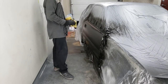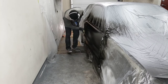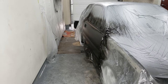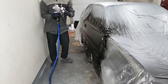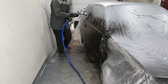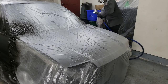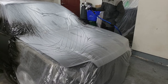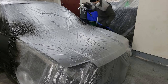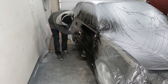First coat all flashed off now, tacking it off for the second coat. Here I had to adjust to a smaller fan to get into the smaller crevices. Here's the final tack off before I hit it with clear.